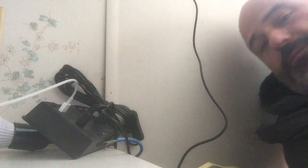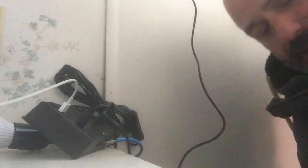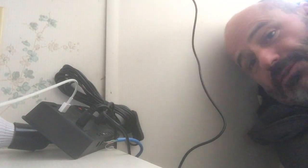Anyway, one thing I learned today: I went outside first to do the hard part — that's the part connected to the battery — and I wired this in while I was out there running it in. Something I didn't think about, and you should always remember: unhook it from the battery before you cut this in. Got a little sparky in here.